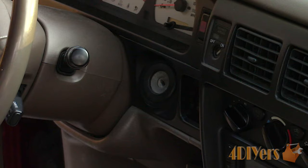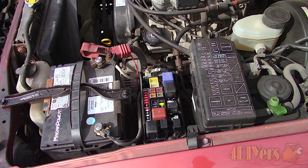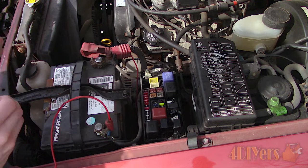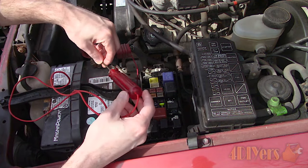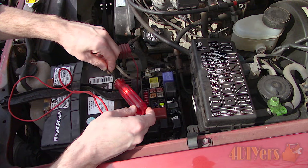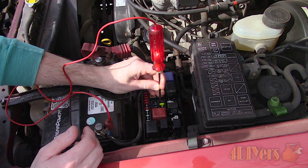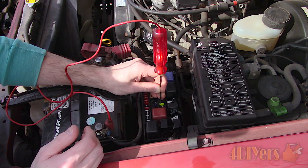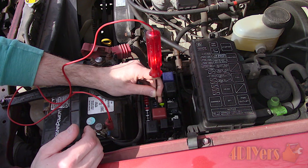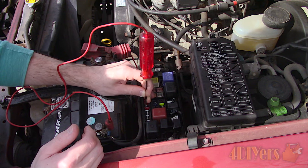Next is turning on the ignition to the run position but with the engine off. This will activate most electrical components. First, using a test light — the ground clamp will need to be connected to a sufficient ground source. With the battery being so close, the negative terminal is a great source. A bare body bolt or bracket can also be used, something which connects to the main body of the vehicle. It's always good to verify the test light is working and you have a good ground source by touching the test light on the positive battery post or a known power source. Next is going through each of the fuses, touching the probe on the exposed test terminal on each fuse. There are two locations to test the fuse on each side of it — one will be the power coming in and the other is the power going out, with the fusible link in the center.